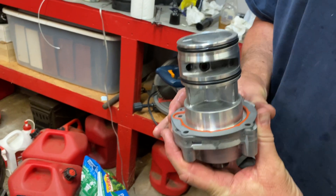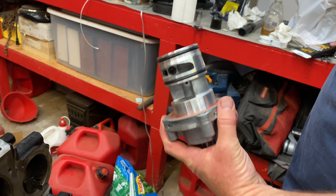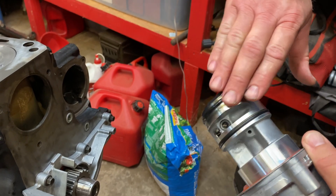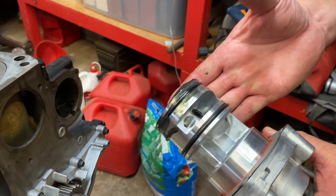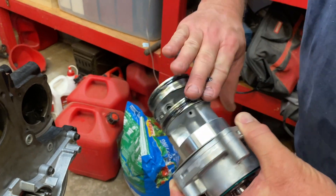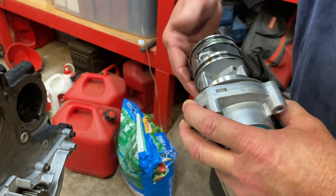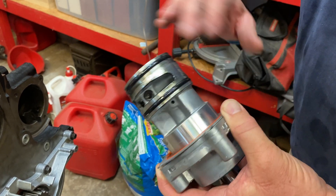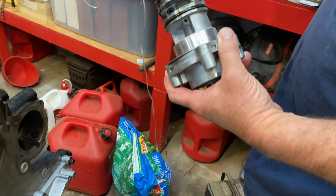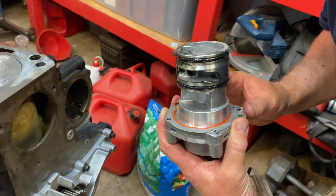So now it's time to go ahead and try to place this in place. But the next thing that I want to do is I want to take some of this lube, I'm going to squirt some on my hand in here, and I want to go ahead and get some around on the O-rings as well, on the oil pump. You could use motor oil as well if you wanted to, but we have this engine assembly lube — it's really slick stuff, and we're just going to use that since we got it right here. So let me wipe my hand off just a little bit.